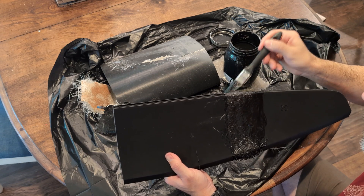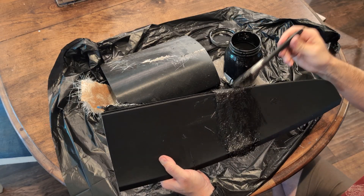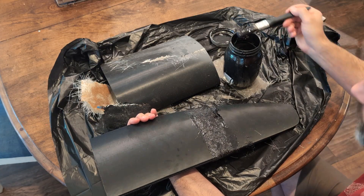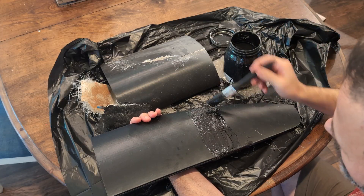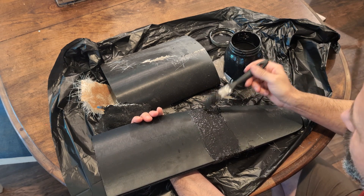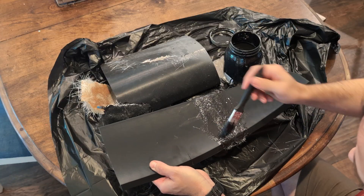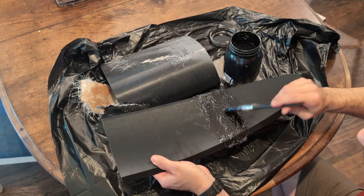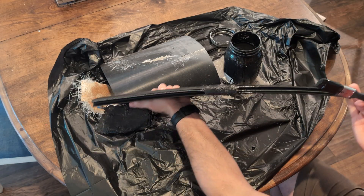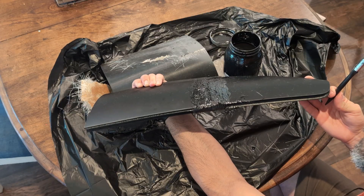The other thing I like about this, besides bonding so much better, is it's much lighter than fiberglass resin, and it does flex — it's not as brittle. You can see this is already starting to dry. I'm just going to put a little bit more just to hide the fiberglass grains and make sure it's soaking up as much ABS slurry as possible. That's relatively flat, so it won't be hard to sand flat for paint.